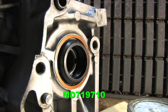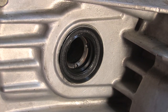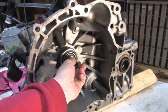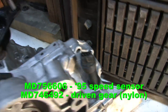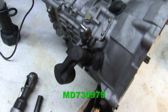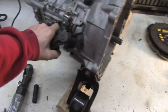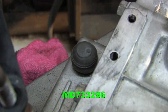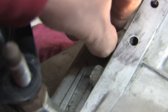Make sure your axle seals aren't leaking — the driver side and the passenger side. Make sure the seal for the output shaft for the transfer case isn't leaking. Make sure there's no in-out shaft play or side-to-side shaft play. There's the speed sensor, there's the reverse switch, and there's the shift linkage. If you have a hole in your transmission, there's supposed to be a little rubber mushroom cap breather. If you squeeze it, sometimes you get gear oil all over the place — that's the breather for the actual gearbox.